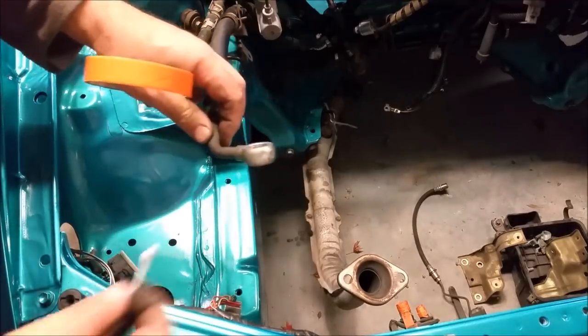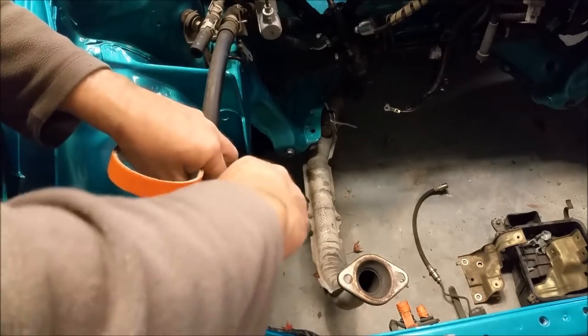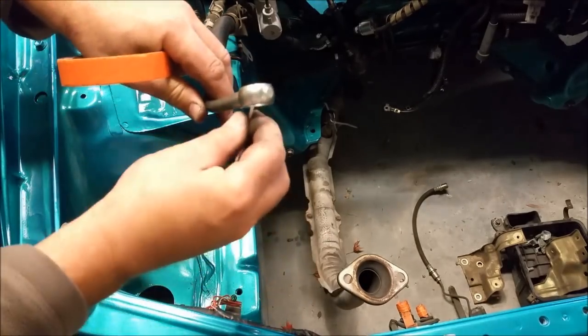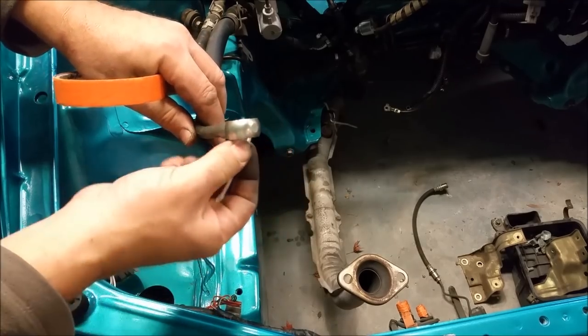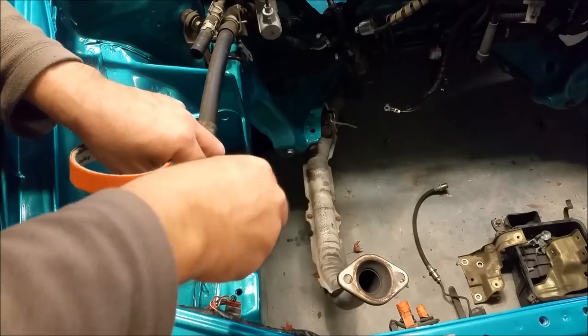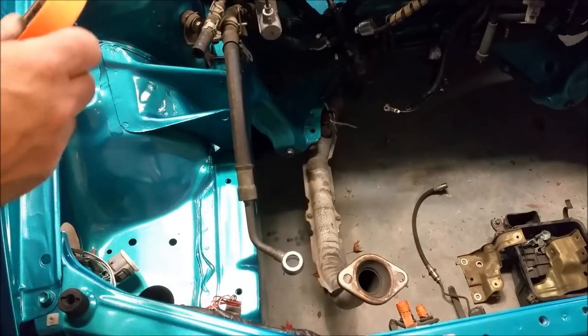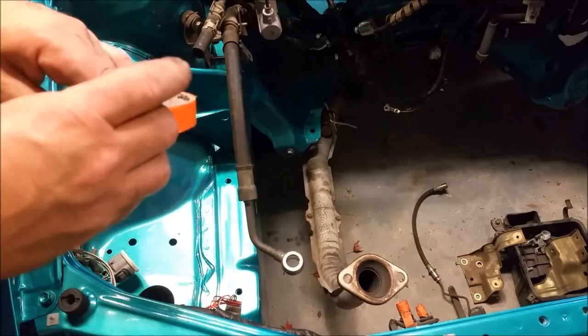We've got our power steering high pressure line. I'm just going to run in there with a cotton tip just to make sure it's clean. There's a bit of muck in there. We need all engine hydraulics to be squeaky clean because dirt will affect the sealing of them. And in saying that, it will drastically shorten the life of the component.